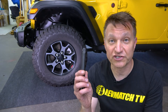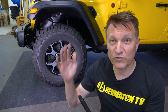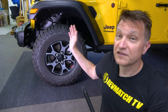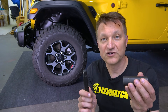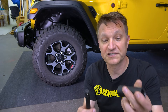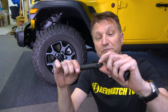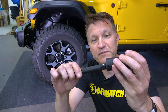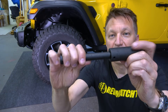A lot of people ask if it's okay to use an extension — and in fact on most cars you have to use an extension because the torque wrench is going to hit the paint on your fender. This is a Jeep so it's got more space than most normal cars, but yes, use an extension. This is a half-inch extension and it's going to go into this half-inch socket. It's got a little ball on it right here that just fits in here — make sure it doesn't pop off.